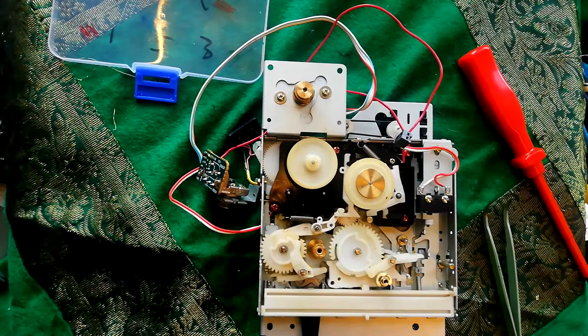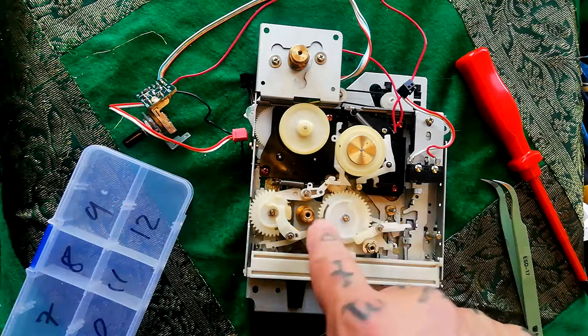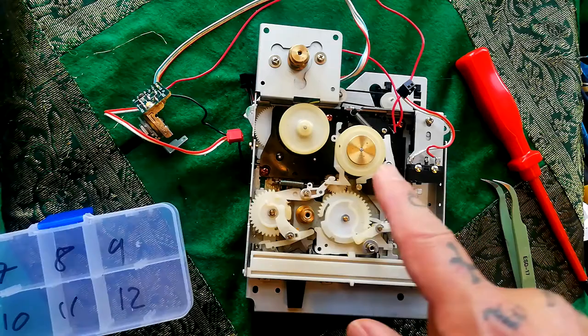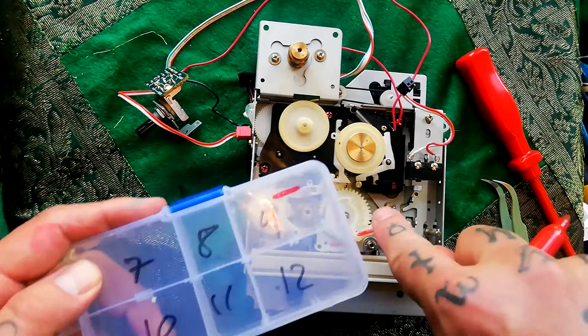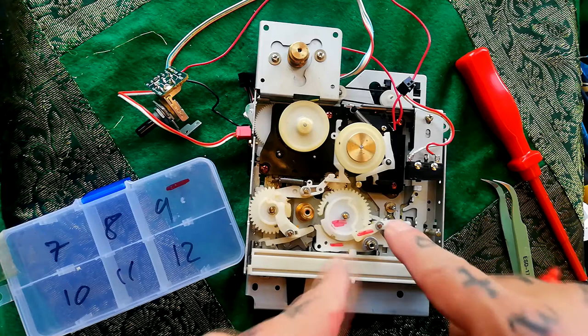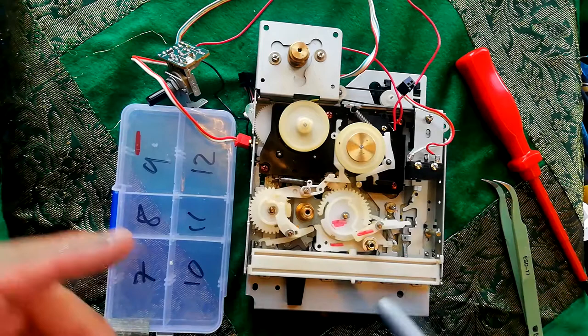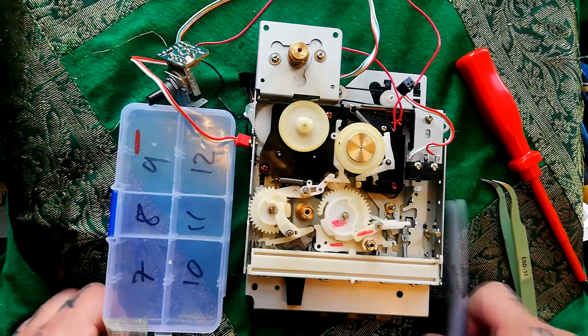There are going to be situations where you want to put fresh grease on, so even though it doesn't seem absolutely necessary in this case, I'm going to go ahead and do that. Once you've got all these cams, gears, levers, and rocker arms lying loose in a box, they look much of a muchness — it's like a really hard jigsaw puzzle. I'm going to suggest grouping things together in compartments in a sequential order, color-coded to the area, so you've got a fighting chance when reassembling of knowing which part goes where and is associated with which part of the mechanism. This is the most fiddly thing I've had to take apart or put back together on any tape deck I've worked on — not an ideal beginner's project, to be honest.